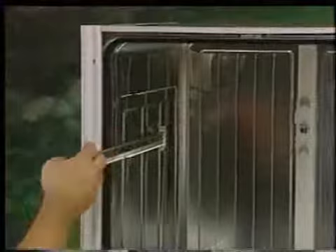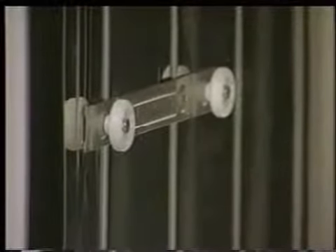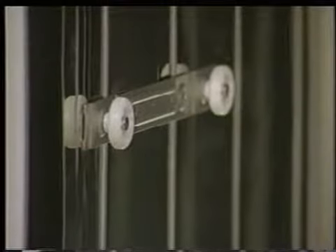The upper rack rails can be removed from the unit by disengaging the rear end cap. To remove the end cap, apply outward pressure to the cap's top tab, unclipping the cap from the rail. Now slide the rail out from the upper rack guide rollers. The upper rack guide rollers are permanently attached to the tank and cannot be removed or repaired.